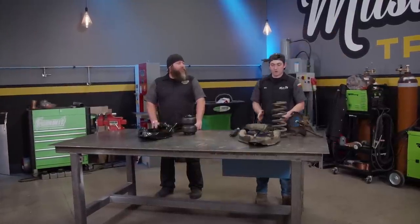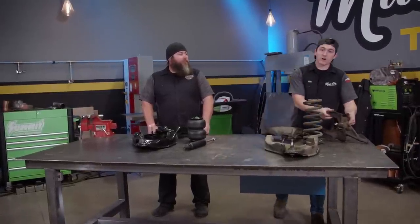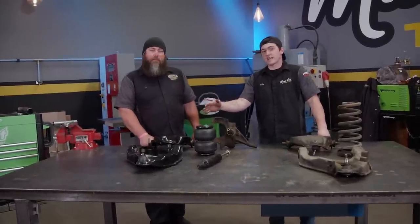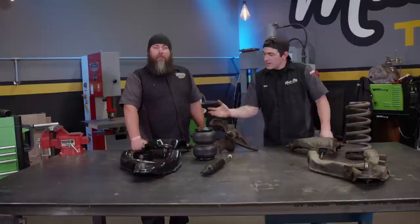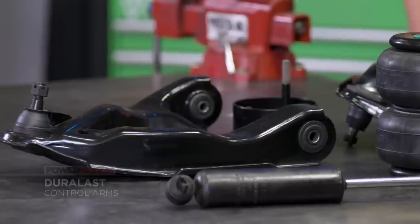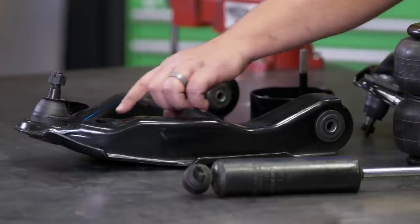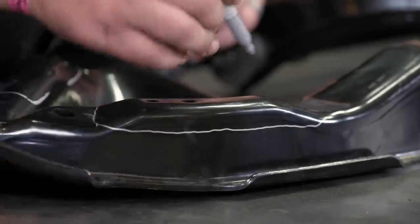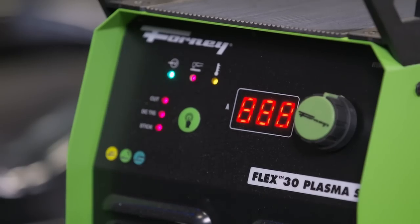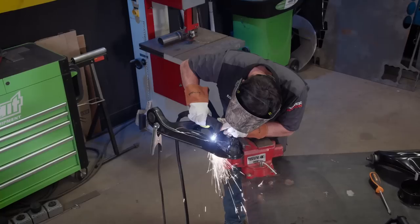Now that we've got our front suspension torn apart, most of these old parts are just going to get thrown away. We are going to be reusing the shocks because they didn't look too bad, and the truck already had drop spindles on it, so we're reusing those too. Over here, we've got some OE style Duralast control arms from the AutoZone Pro website. Ben, why these instead of tubular control arms? Tubular arms are expensive and rebuilding the original arms with ball joints and bushings is a lot of labor. We can start fresh and modify these lower control arms so they don't hit the frame and we have clearance and mounting for the air spring. The first thing we'll do is mark where we need to cut for clearance.